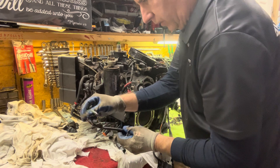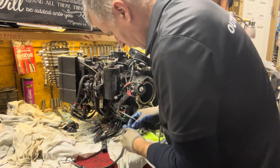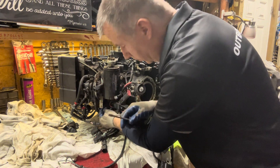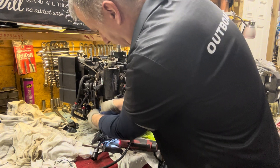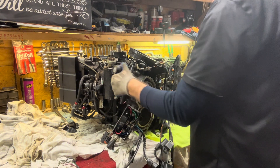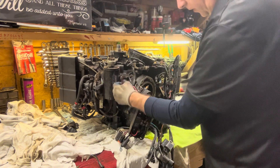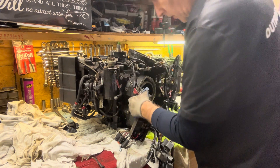This goes to our trim switch that I don't think was functioning — we were jumping it out. I have a little parts bin here; I'm putting all my parts in. Now what I'm happy to see is how clean and nice and neat these wires are here. I like to put as many screws back in as you can because it just makes it easier later on. There is a primer solenoid wire here — it's always the purple wire on these Evinrudes. Got our starter solenoid tied in so we can pull that off, separate it from the starter motor. There's another ground here with a little star washer, so I'm going to put that star washer back in place with the nut.